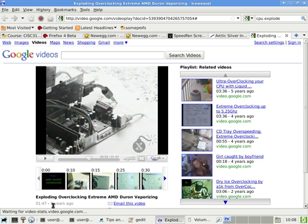Okay, so what happened here is, if you look at a processor, it has a substrate material, basically a backing material. The processor chip is actually here. It is really small compared to the entire package. On top of that, they have some more stuff, basically the heat sink, which is a lot bigger than the die itself. So this is entirely enclosed inside. And normally the heat will go through this material, go to the CPU fan, and then get dissipated.